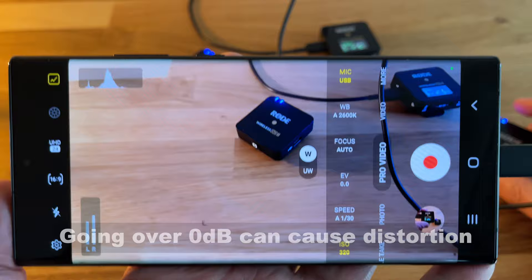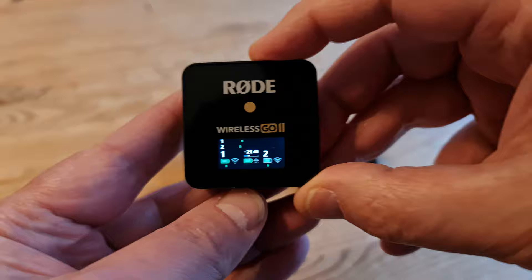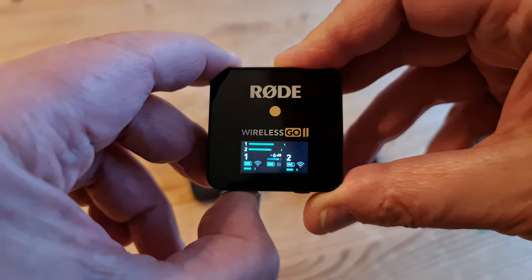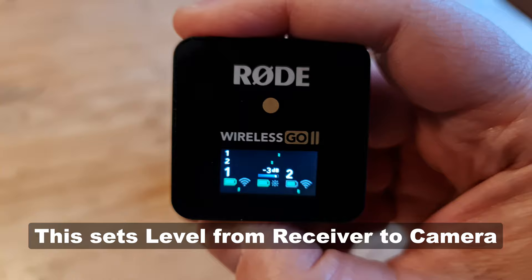The gain controller is a button on the bottom of the receiver with the microphone and the letters dB beside it. Pressing this button moves between gain levels, and how much it moves depends on how we have set up the gain control using the Rode Central software. The receiver is set to fine gain adjustments. When set to fine, we can go from minus 30 to 0 dB. If we start at 0 dB, one click takes us to minus 30, and each further click increases the gain by 3 dB — so minus 27, minus 24, minus 21, and so on, until we're back at 0 dB.